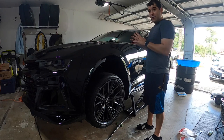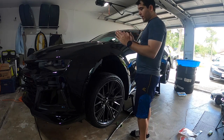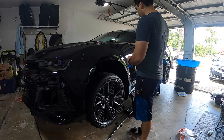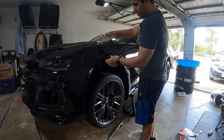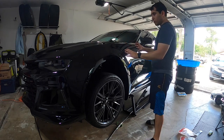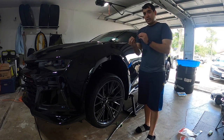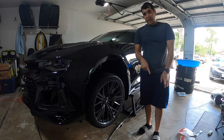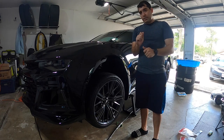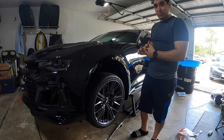The wiping away is honestly the hardest part of this process. Now it's time to actually apply the ceramic coating. The instructions say to work in a three-by-three foot area — take it in small sections at a time. For this fender, I'd split it into four pieces and work through small sections. The kit provides gloves, applicators, and the UV light, which I'll show you how to use in a moment.